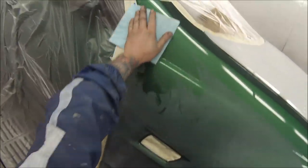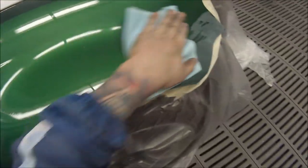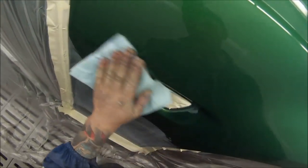You've got to make sure you wipe it until it's completely dry, or else you can be left with a film. We'll be running over that with a tack cloth and high air pressure at the same time after it's all been prep soled down. Just doing the blends first up.